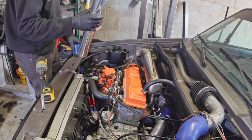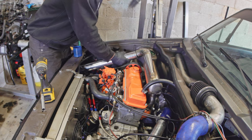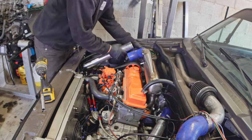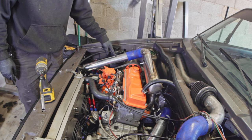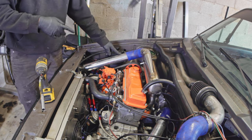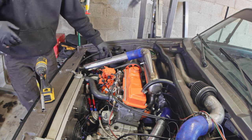Pipe number two is cut to size — go ahead and install. There we go, that's pretty close. I think a straight coupler will do. There's our test fit of the second pipe. I need to add some sensors to this one — namely a pressure sensor. I also need to add where my boost tube was and re-tap it for a sensor.